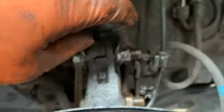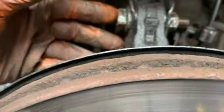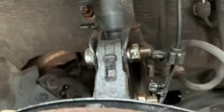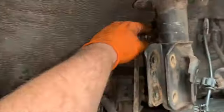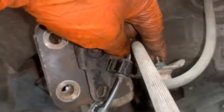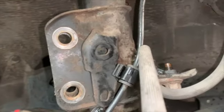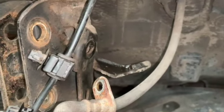So we're going to undo the two drop link bolts — I've already got the wiring out of the way on this side. Biz them off; I think they are 19s or 21s — I'll confirm in a minute. Luckily we got these off and they didn't break, so that's always a bonus. Drop links out — two 19s here. And I forgot about the brake pipe. Being Japanesey, I'm going to say 12mm — it was indeed a 12.